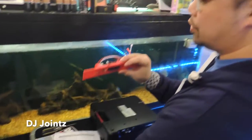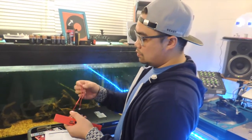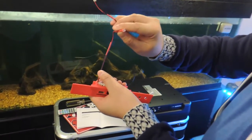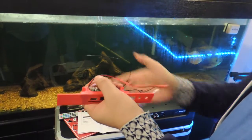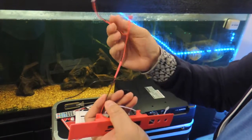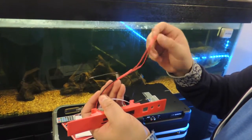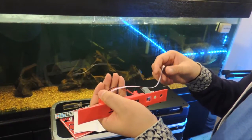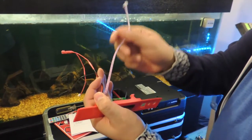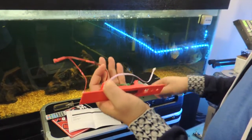Yeah. So you've got your plate. Your plate should come with these two connectors. There's this red and black wire with two connections, a female and a male, and then you have a white wire with just a male connection. Now this actually plugs into your power and then bypasses from the board back into the mod, and then the audio goes from the PT01 plugs in here, and then this one is the audio going out from the mod back into the PT01.